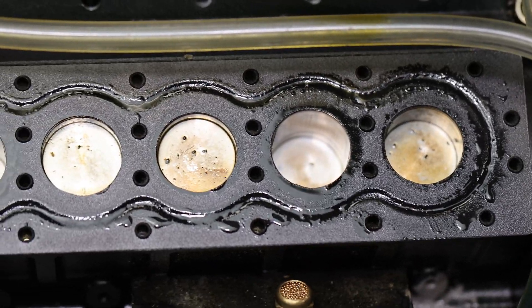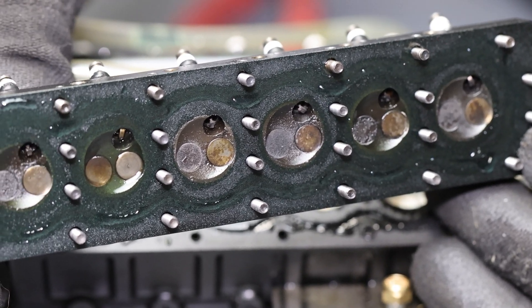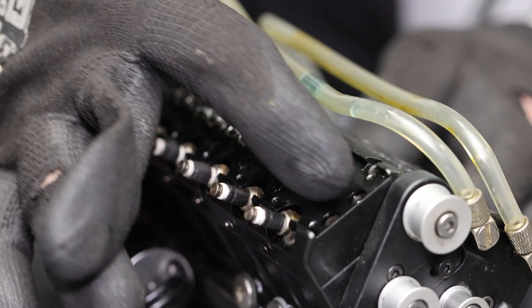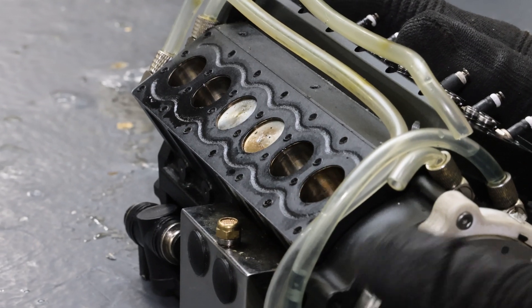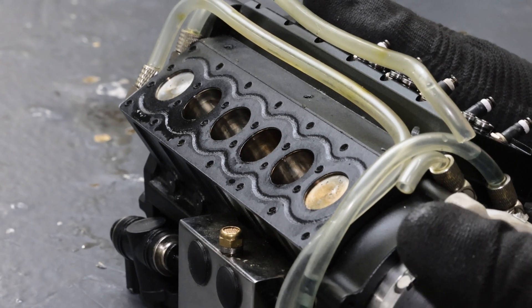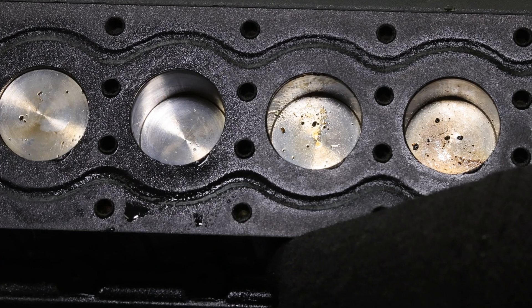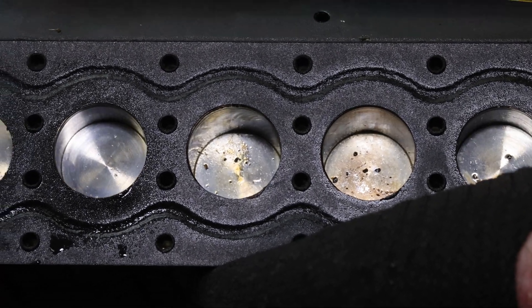I already see a bunch of blow-by. Let's take a look at the bottom of the head — a couple of those valves are different colors, interesting. All these valves are closed on this side, the head is untouched. When I rotate this I should have some resistance or compression on the other six cylinders, but this is turning pretty easy. That's telling me these piston rings might not be the best — I really don't have much compression at all. I do see some metal particles on the pistons, and I definitely saw some metal in that oil.